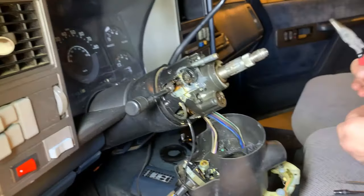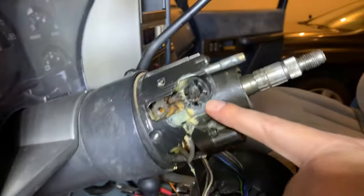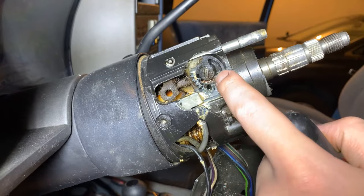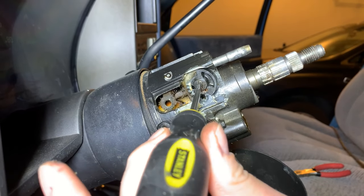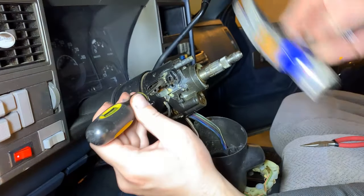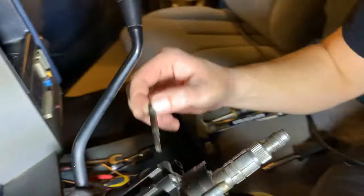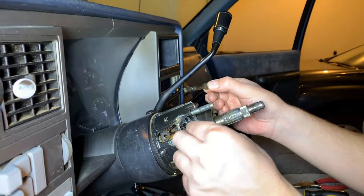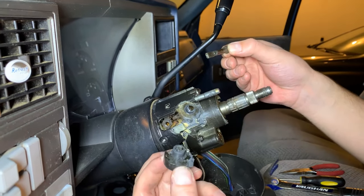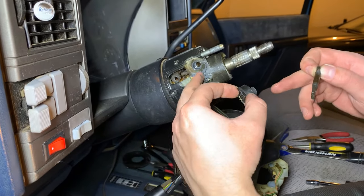This spring will come off our pin, and the pin will kind of float around now. I tried to push this pin out but it wasn't working because we need to get this gear off. I'll place my flat screwdriver right on that pin and give it a few taps — there it goes. Now I can pull that pin out from the other side, and this cam should come right off. It only goes back in one way because it has a little notch that it sits in.